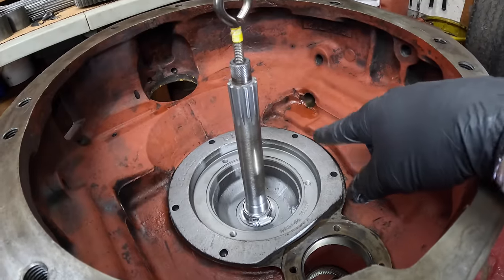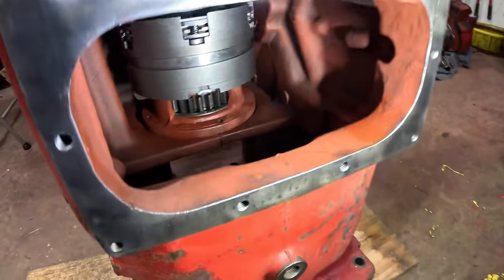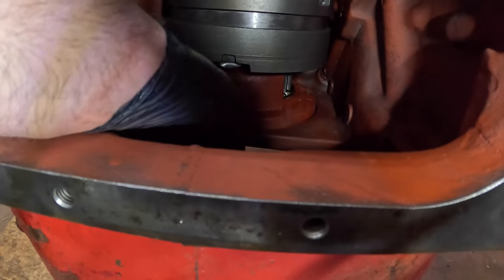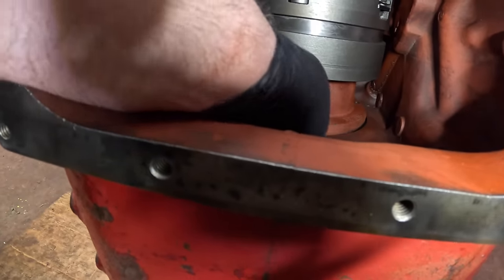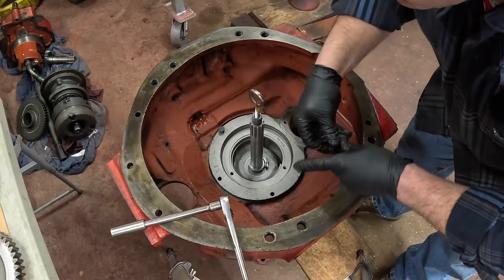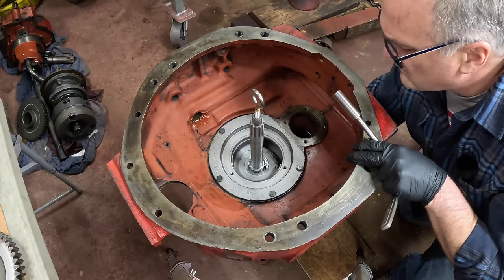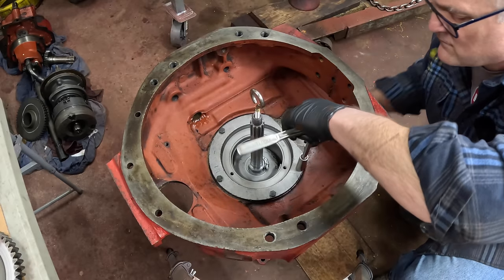The TA is just setting in there - the top flange of the TA is taking the weight onto the case. Check down and the quill gear housing should rotate, and it does. It's against the bottom baffle, but it's free. I'm going to put these front bolts in and snug them down to approximate torque, while checking to make sure that the quill gear housing still rotates. Nothing's binding.